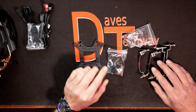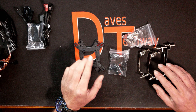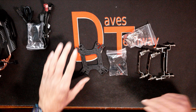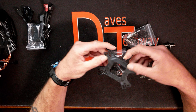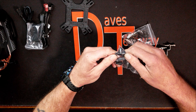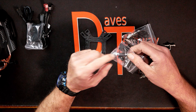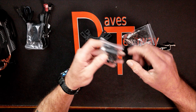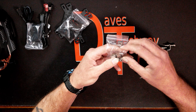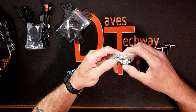Looking at the bottom, this cooler has a complete copper base plate that attaches to the aluminum interior, and there are six heat pipes running through it. There don't appear to be any spacers between the fins, but with all the plastic on top you shouldn't be bending fins anyway. Even though the heat sink is bare aluminum, it still looks pretty good with all the black plastic covering it. It feels like a beefy, well-made cooler. The total weight is 2.47 pounds, and it was first available on March 19, 2021, so it's still fairly new.